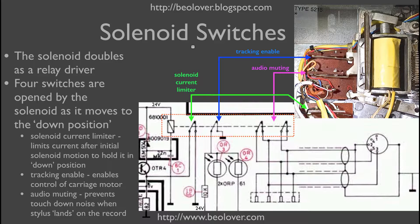So if this here is interrupted, which I found it is in this turntable, then what happens is that the switch opens after the first inrush current pushes the solenoid down and then that breaks the current entirely. The spring then pushes the solenoid back up and the cycle starts anew — the solenoid pushes down, the switch opens, and it goes back up. So you get this up and down oscillation of the linkage.